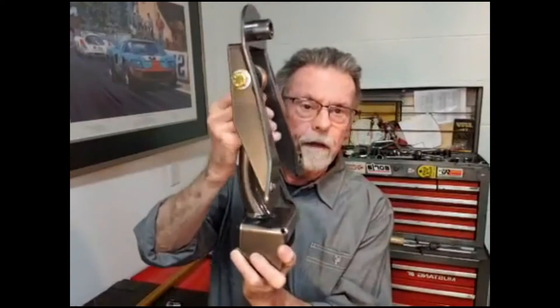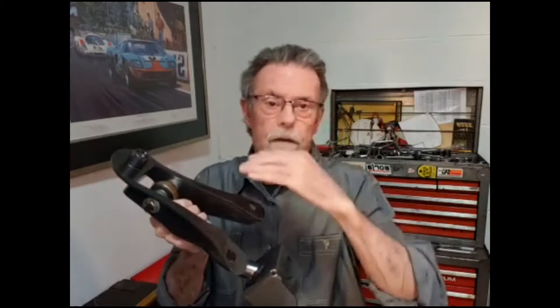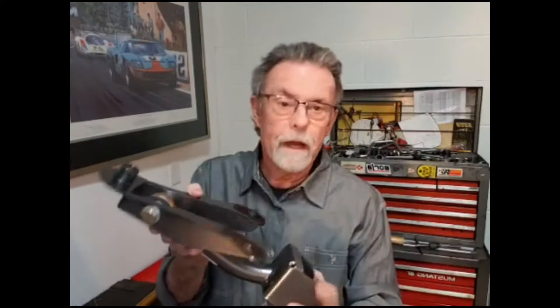You'll notice the arm is bent — everybody else in the aftermarket has a straight arm. But if you're running a car low, like a track car, and you hit a big bump or go off track, a straight control arm would hit the tunnel. We curved it so there's enough room for a big suspension travel without hurting the control arm or the tunnel. It's also longer than stock, and the pickup point is significantly different, which supports the side-view geometry.